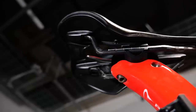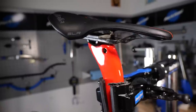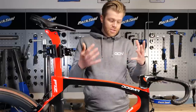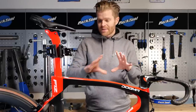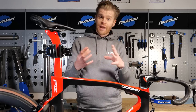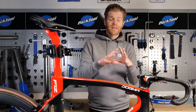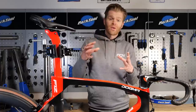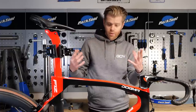so that's worth doing. The underside of the saddle, most plastic components feature a lacquer on them as well as part of the finishing prep of plastic components, so you can do it to plastic stuff too. In terms of metal frames, alloy frames, sometimes they are lacquered as a surface finish, in which case, yes, you could ceramic coat them, but some aluminium frames and titanium frames have a bare finish or they're anodized, in which case a ceramic coat is not gonna stick to those. So yeah, you can't ceramic coat those.